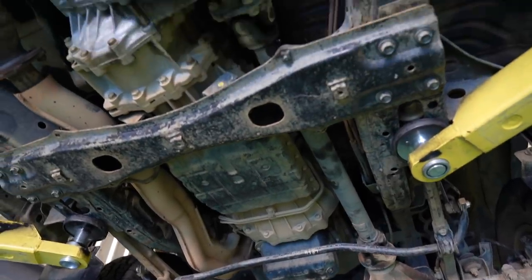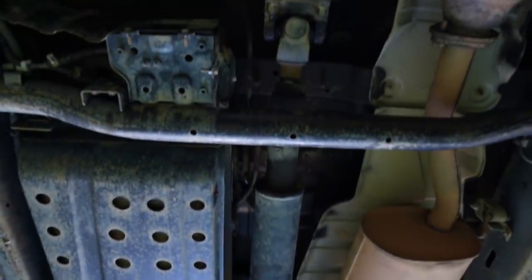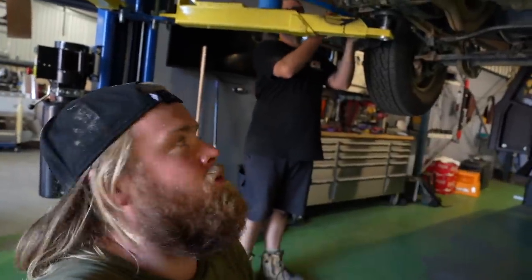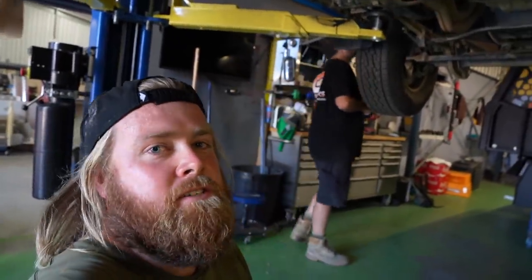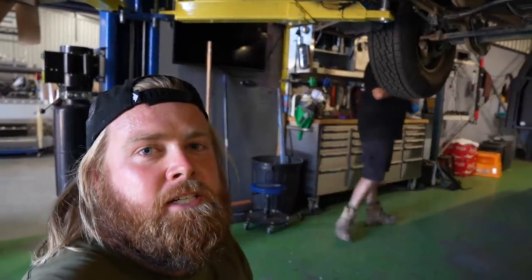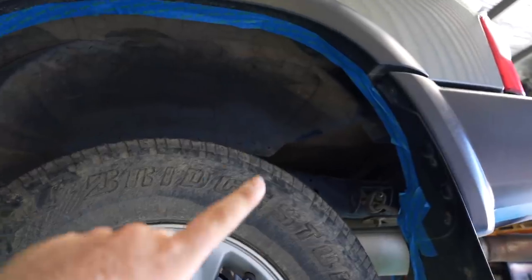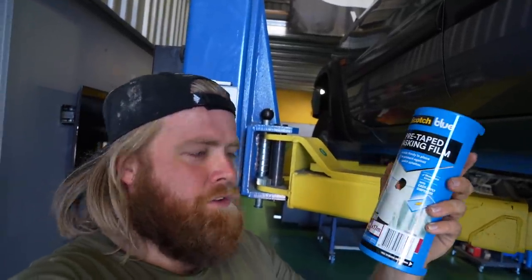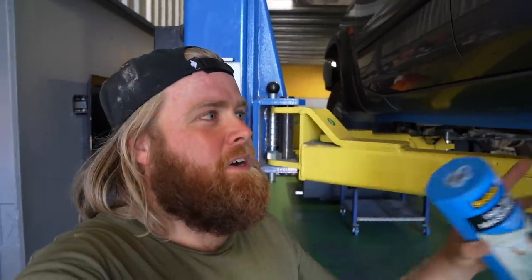Came out reasonably clean up under here. The idea is I just want to paint the chassis rails, the cross members, and the diffs. All the suspension components are being replaced, and you don't really need to do the transfers and all that sort of stuff — just going to paint up as much as we can, rust-proof it, and it should be good. There's the tape all around those wheel arches and down the sides — doing around the whole car. That's the pre-taped masking film I got from Bunnings, so we'll drop it all down to create a little room in there so we don't wreck the G-Works workshop with paint going around everywhere, and also so it doesn't come up the sides of the car.